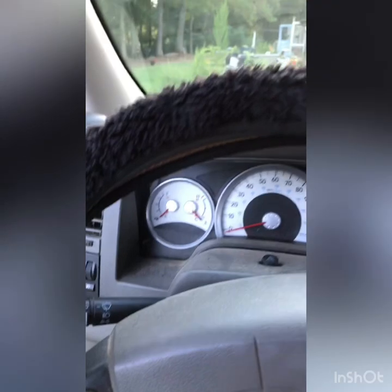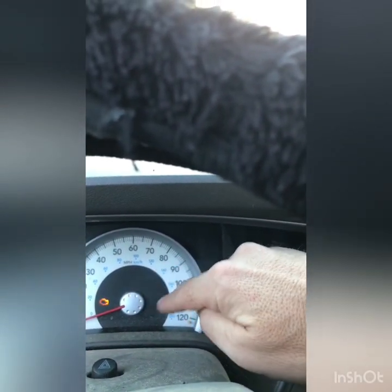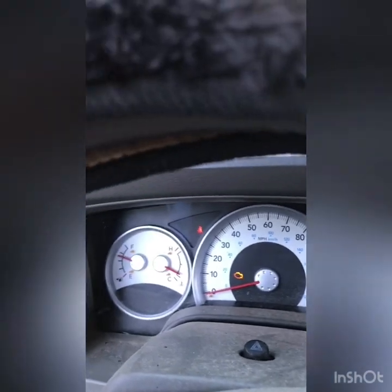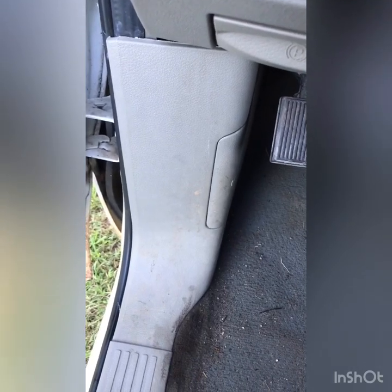Part of this — my gauges were just going crazy. There was a red light coming on up here. All my gauges would come up and then all the gauges would drop to zero. Fuel would drop, oil would drop — everything was dropping, but it wouldn't do it until it was running. But yeah, this is a for-sure fix. Just make sure you clean that board really good, cover back up the parts that don't need to be showing, and there you go. Thanks for watching our video on a DIY 07 Dodge Durango panel fix for water damage. See you guys later.